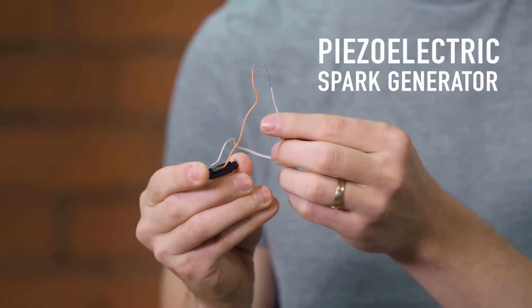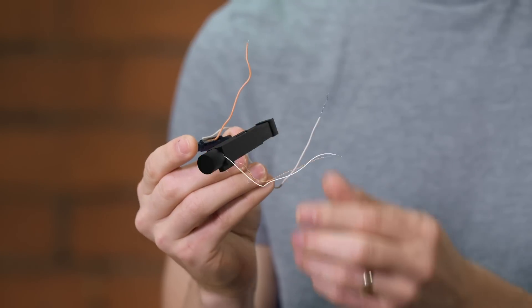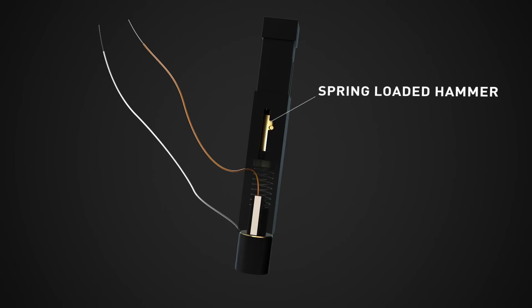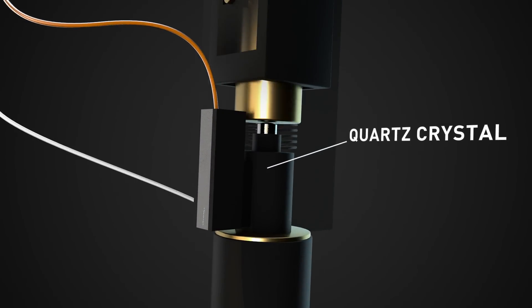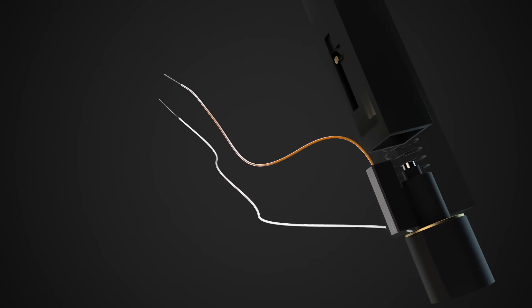It's the same kind of thing that you'd find in your home boiler or a barbecue lighter. This works as a result of a natural phenomenon whereby some materials, like the quartz crystal inside the spark generator, accumulate an electrical charge when compressed or struck with force. It consists of a small spring-loaded hammer which, when the button is pressed, hits the quartz. This sudden impact produces a high voltage and subsequent electrical discharge which travels along the wires creating a tiny spark at the end which ignites the gas. Fun fact: quartz is the second most abundant material in the earth's continental crust — that's the bit just underneath the land — and is used for all sorts of applications from ultrasound devices to mobile phones and even atomic clocks. I actually made a video about how atomic clocks work which you can find somewhere here.